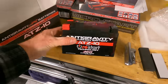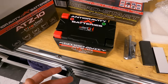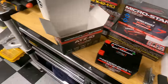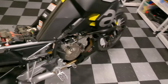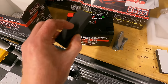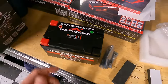One more thing I'm doing: installing an Anti-Gravity lithium-ion battery with restart technology. Even if you discharge the battery completely — maybe you left something on — the restart technology reserves enough power to still start the bike. The factory battery is already lithium, but I'm swapping it for the Anti-Gravity unit. They include really good terminal hardware, spacer blocks to make it fit perfectly, and there are terminals on both sides — two positive and two negative — so regardless of battery orientation in the bike, you can use either one.